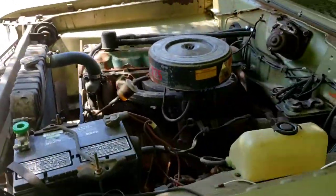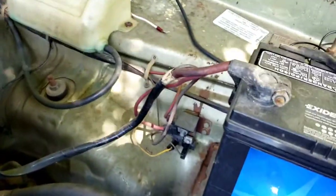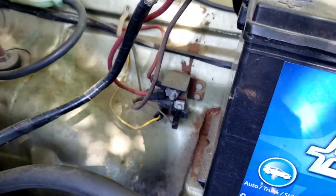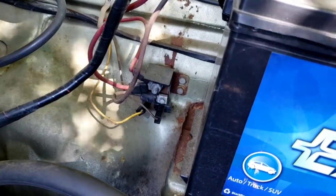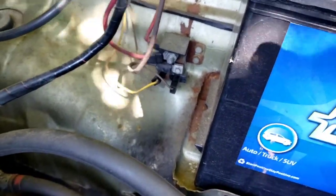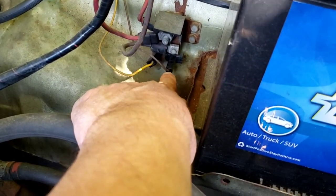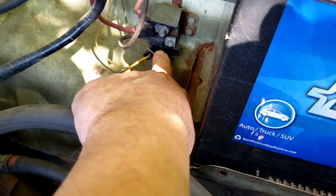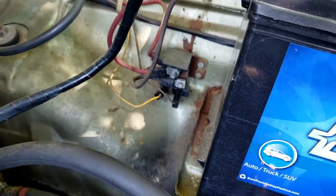That's how a Chrysler starter relay works. If you ever get stuck on the road or at a car show and wonder why it doesn't crank, check those things — bring a test light. I got stuck once without a test light, and the problem turned out to be the neutral safety switch. Actually, the wire inside the connector was broken — even though the connector looked fine, the wire itself was not making contact, which caused complete havoc.